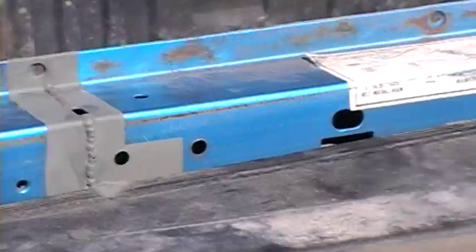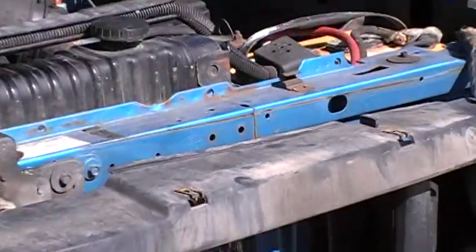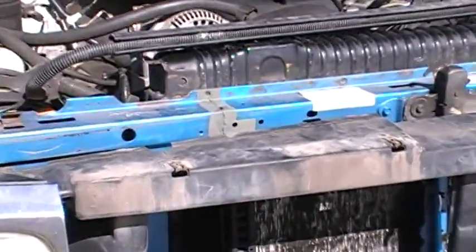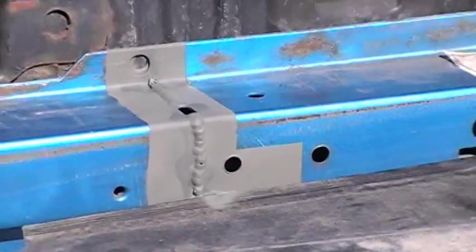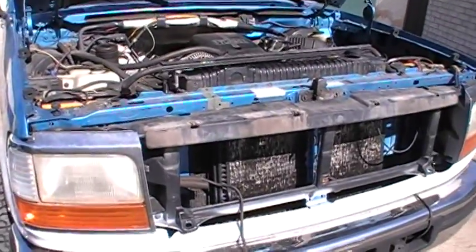That's what it looks like right there. I've got one more side to do — up for stress crack on this radiator core support on top. And I have one more on the driver side lower floor board. There's also a known area for stress cracks to happen. I will show you guys that one a little bit later when I get to it.